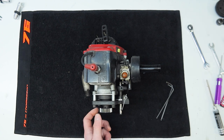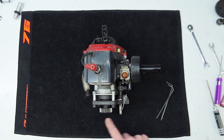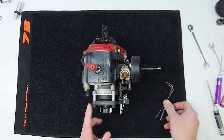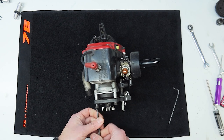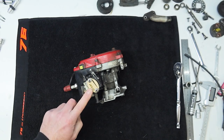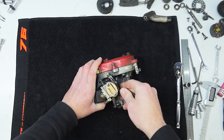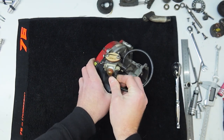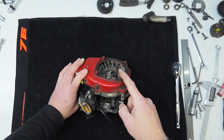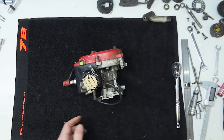You can see that bearing is running really well — it feels nice and solid. Same with the layshaft, make sure the bearings are okay in there because this is a plastic holder so they can fail — you can get an aluminium upgrade but the plastic one is doing alright. I've put a block-off plate on the intake, one on the exhaust, and I'm going to link the fuel lines up so we don't get any garbage in those. I've also taken the pull starter off because the internal mechanisms don't like degreaser.